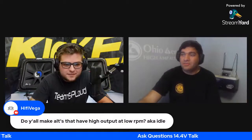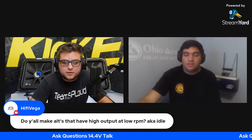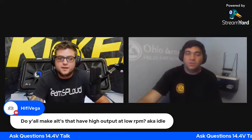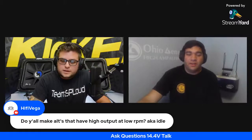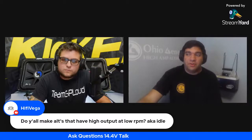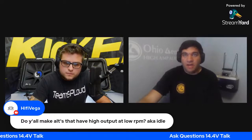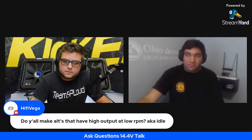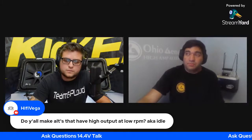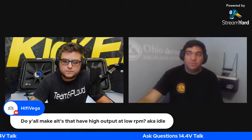Let's see here. Hi-Fi. Do y'all make alts that have high output at low RPMs, aka idle? So we have 2 variants that are most commonly used. A small case 128 and a large case 138. The small case does about 180, 190 at idle, assuming you have a 3-to-1 pulley ratio. The pulley ratio is very important. 3-to-1 is a standard measurement, and then the large case does 240 at idle with a 3-to-1 pulley ratio.